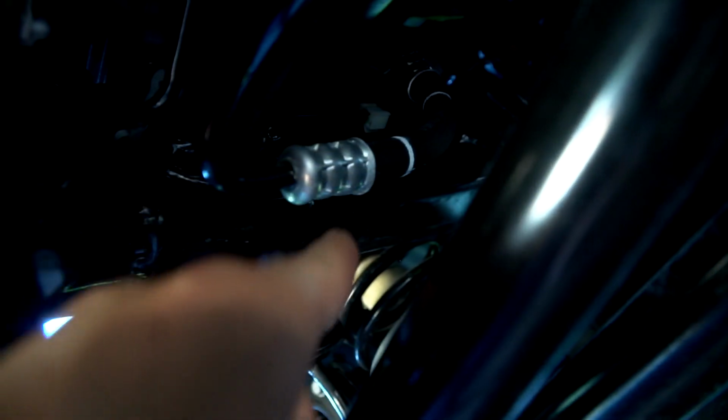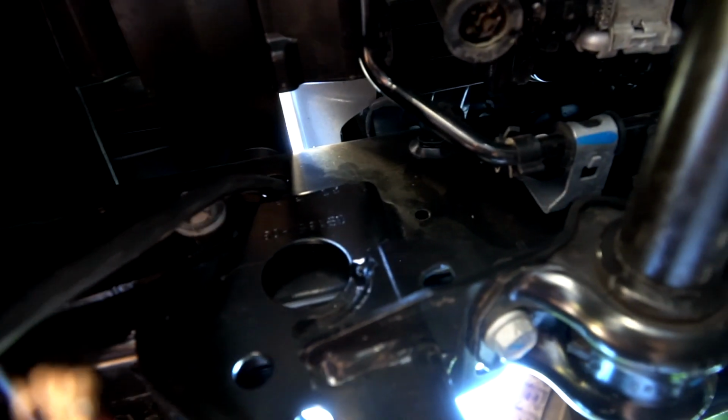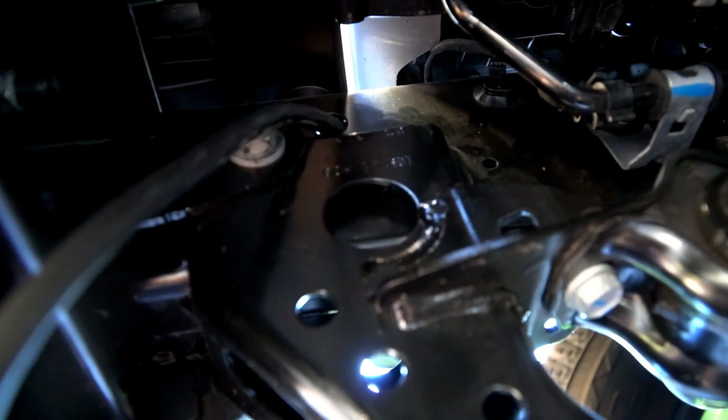So that's going to be the wires that I'm going to connect to my plug in the front of the Jeep. The advantage of coming through the frame, or a couple things, is there's a lot of areas in here that are hot: exhaust, engine, cooling hoses, etc. So by doing this, you can really eliminate any of the hot parts, and it gives you a nice clean install. No one's going to ever see this wire when you're done. So we'll show you how we connect it to the plug up front.